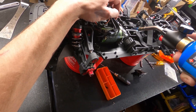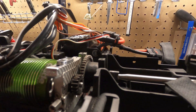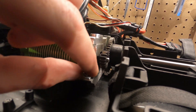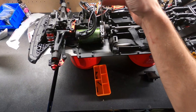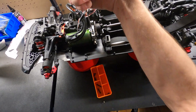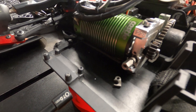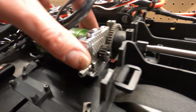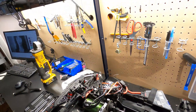A little bit of heat to get this motor loose. I'll leave a link in the description for this PPS motor mount — it's really nice. You got this little set screw right here, so once you take off the screws that hold the motor in place, this sets your mesh — you just push it back and forth and it slides very slowly so you can set the mesh perfectly. You just put your little tool right here and you can set the gear mesh. Looks like I broke mine — I think a screw just popped out and I just gotta find a screw that fits in there.